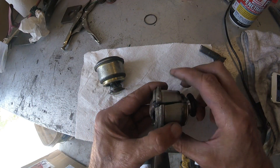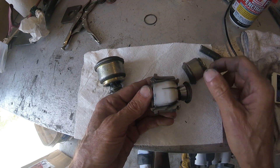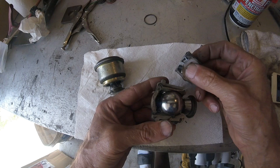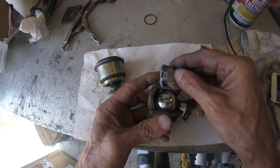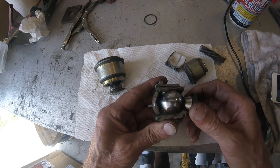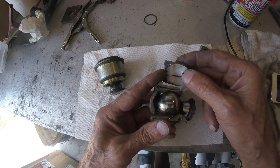Inside the ball joint — I split it with a cutter — so you pull this housing off here, and inside it's got a plastic insert. That's why these things wear out so fast. The Jag was 18 years old, and plastic under pressure will start to creep a little bit and move around on you, getting some clearance between the ball and this insert.